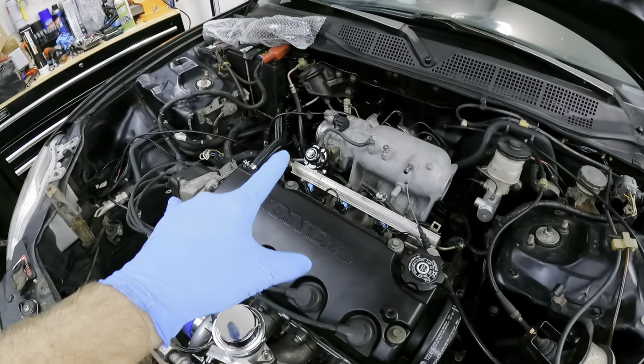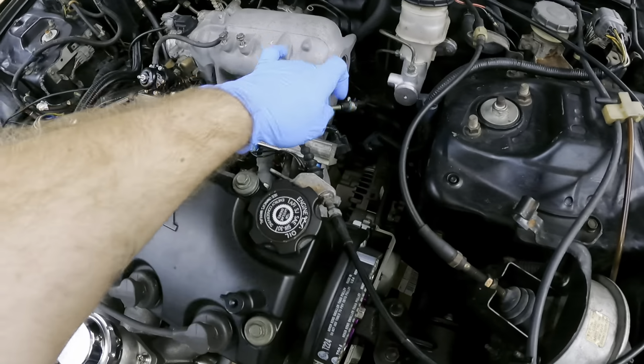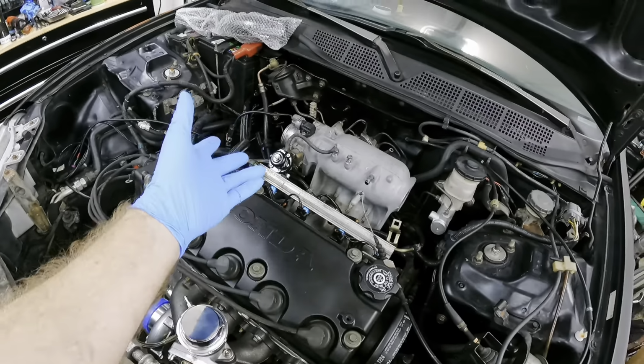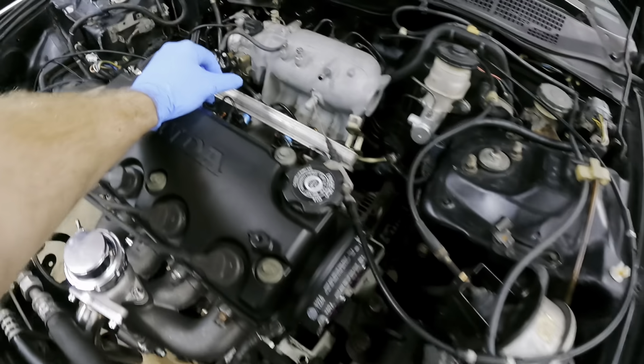We're getting the Bull Boost intake manifold and fuel rail. I've read reviews and I know that all their holes are drilled through, and I know how to fix all that, so I'm not worried about any of that. It'll relocate the FPR from here to here, so we can eliminate this hose, this pipe, all that, and this will just plug right in. It'll be a little cleaner. Obviously, it'll be a nicer intake manifold. I have a bigger throttle body we might use. I'm going to try to pop this one off and see if the gasket breaks or not.